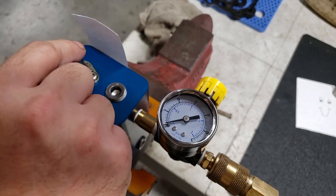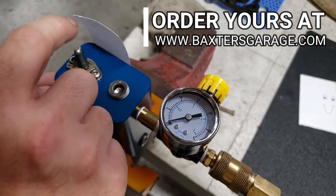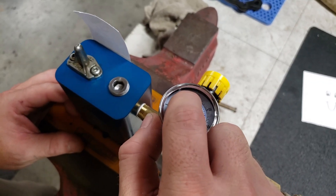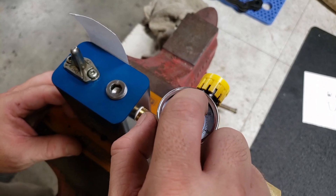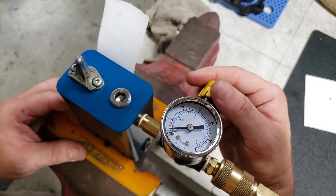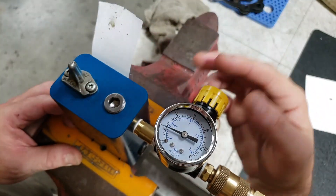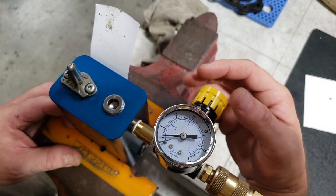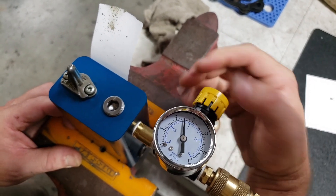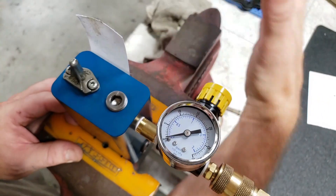A recap from the video — this is a piston jet assembly here. This is the Gem 772 piston oil jet tester. The way this should operate is the check valve in here should stay closed until we hit approximately 12 to 13 PSI, and be wide open at 15 PSI. But watch this one — we're already moving the paper and not even up to 5 PSI yet. At 5 PSI we've got flow, all the way back down to zero. So the check valve in this one is not working, meaning at idle and low RPMs your piston jet is going to be spraying all the time.